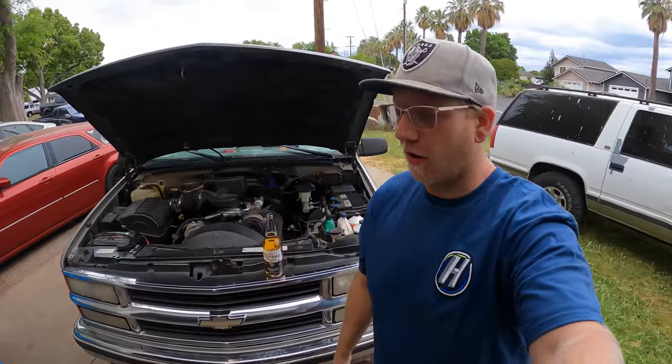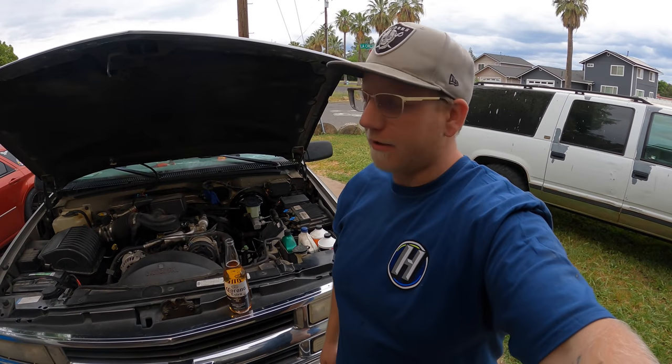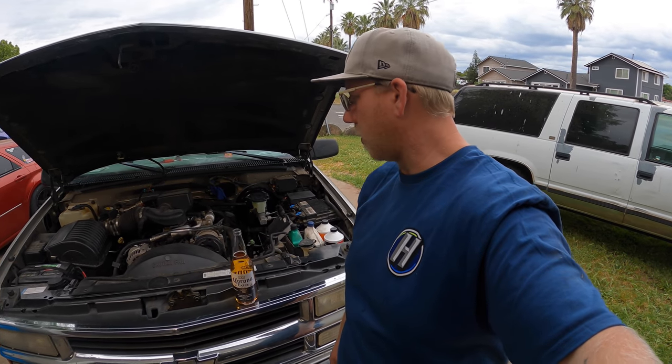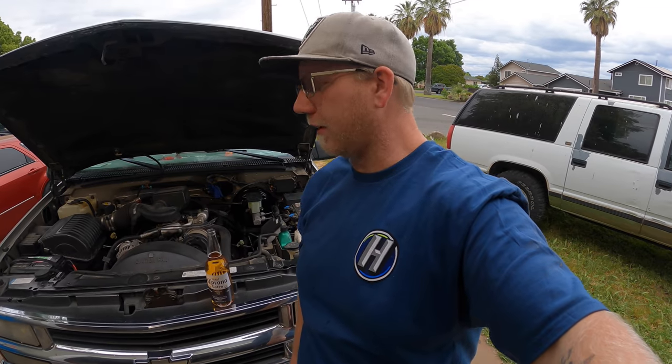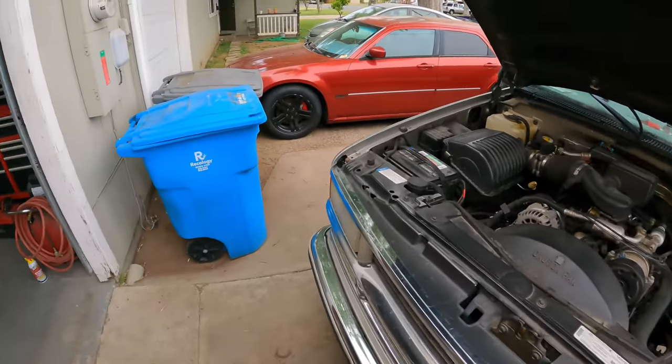Well, that's gonna do it, guys. Job well done. We are having a bit of a problem bleeding the brakes at the moment. I can't get the bleeder bolts broke loose on the front calipers, and they feel like they're gonna rust out. So it's drivable for now, but you can tell there's still a little bit of air in the system. I think the next step when he's ready is to just get some calipers, and then we'll bleed it again then.